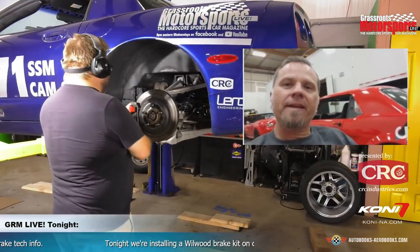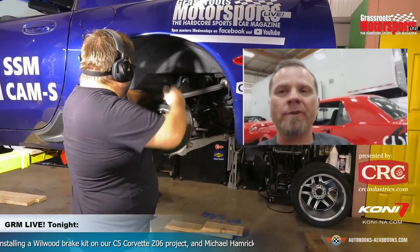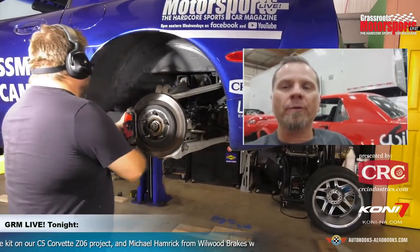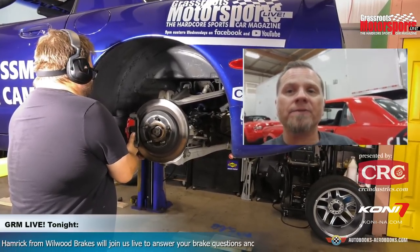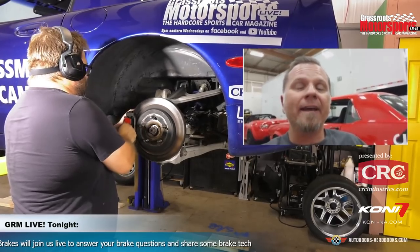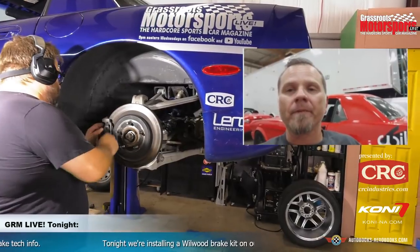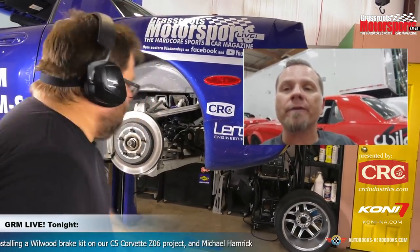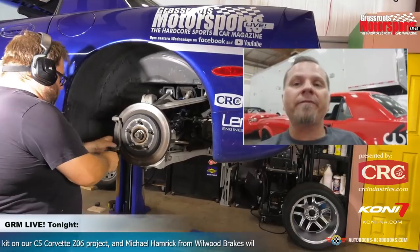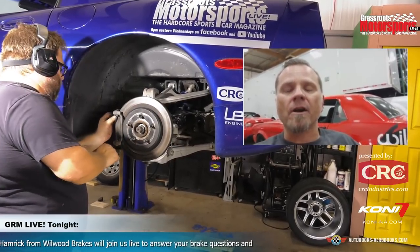Well, that's kind of a loaded question. There's a lot of answers to that. So when we're dealing with a customer who's buying a brake kit like this, we'll go through and find out what their skill level is, what they're going to be doing with the car, what tire they're going to be using, what track, autocross. Is it a tight autocross? Is it a wide open autocross? Get some feedback from them so that we can select brake pads that are going to work optimally for everything that they're doing. In this case, we've been dealing with quite a few of our customers that have given us really good feedback over the years, and we've been testing what's called our BP30 material. So that's what I've sent you guys for this car.